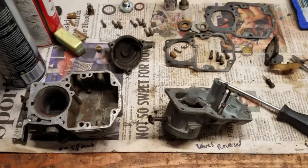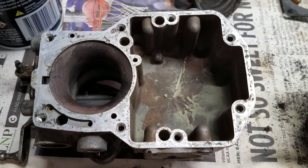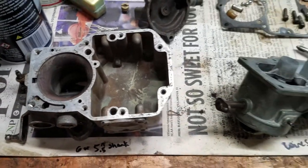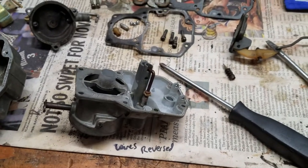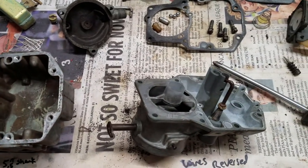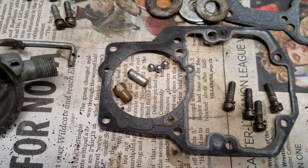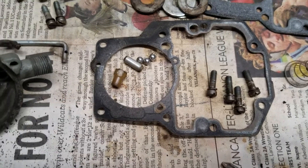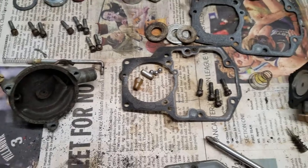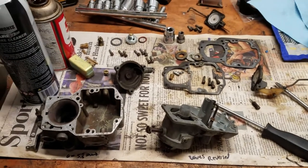There were a couple of issues with the carburetor, but the thing that jumps out right away is that this rebuilt carburetor is not clean at all. I think the previous owner only put in new gaskets and power valves. So we're going to give it a thorough cleaning and then deal with some other issues I found — including these check balls. There are three of them plus a weight, and they were not in the proper positions based on YouTube videos and the shop manual.